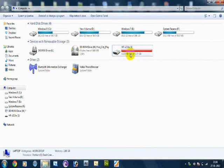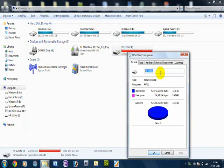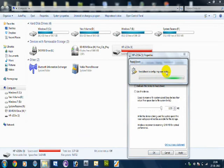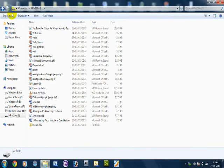If your drive is also auto-connected, you can just right-click it again, go to Properties, go to ReadyBoost, select 'Do not use this device', and press OK to configure your cache. Then you get the memory back.